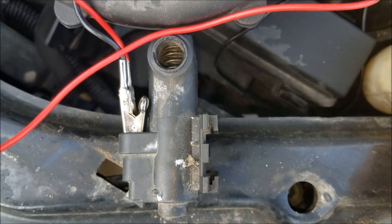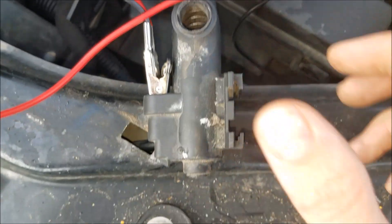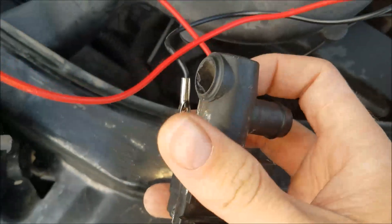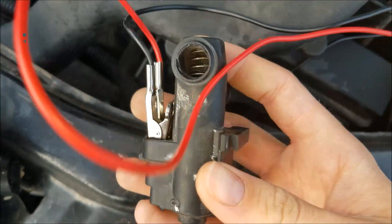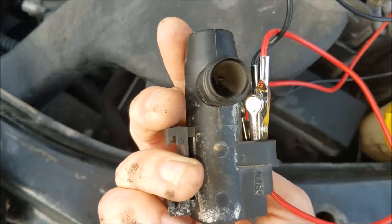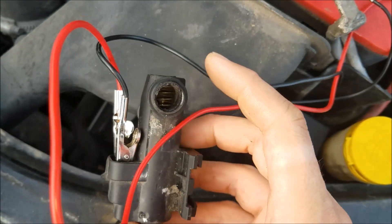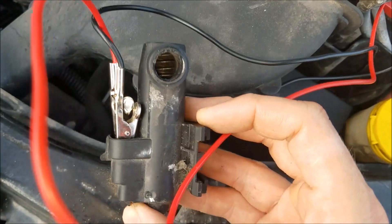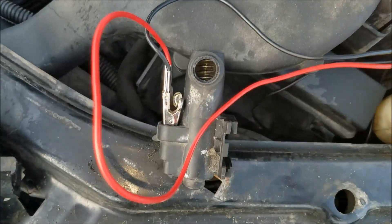What happens is moisture gets trapped inside, the valve gets stuck open, it's not closing like it should to build pressure, and you're getting that P0455 or P0499 code. That's all you have to do to test it. You don't have to disassemble it this much to test it — this was an old one so I figured why not — but hopefully that helps with seeing visually what the valve looks like disassembled.